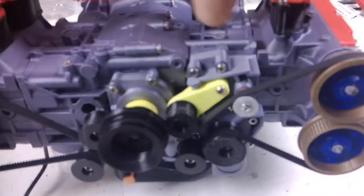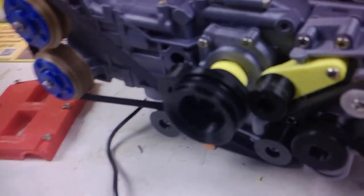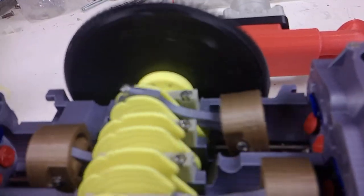Subaru has an air conditioner here, the alternator here, the power steering pump over here. I resized the pulley from the Toyota. I mounted it to the crankshaft pulley. It would be belt driven to different parts. I can remove the belt to remove the top of the engine. And it looks like I need to repair a piston — looks like it came disconnected from the rod.